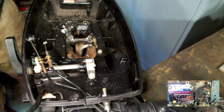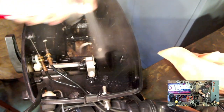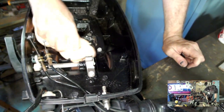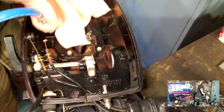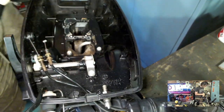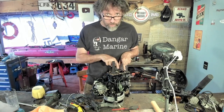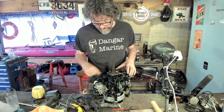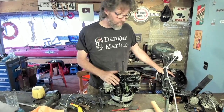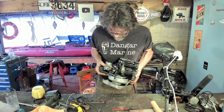This is just a bit of brake cleaner. If the gasket on that powerhead stays in as good condition as this one, I think I'll just put a bit of sealant on it — it's a nine horsepower, so that's okay. Let's put this aside and then get the powerhead off the other one — same process. Hopefully goes as easily; maybe not, it's older.